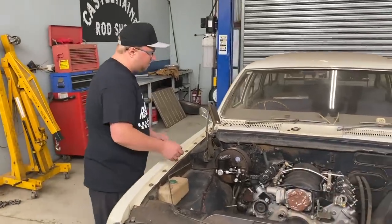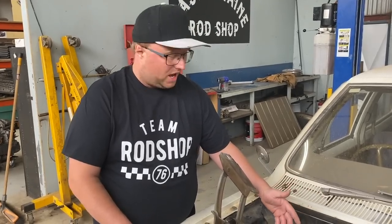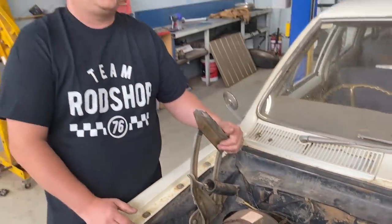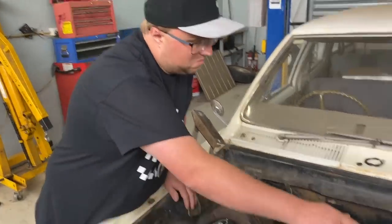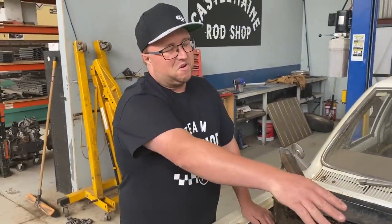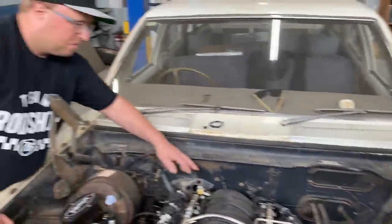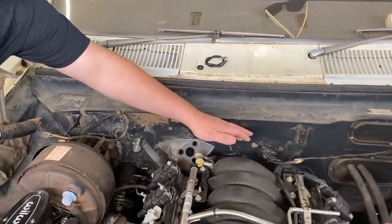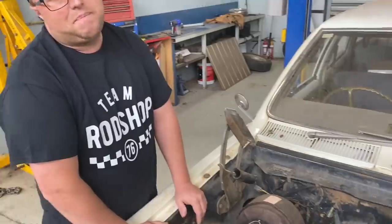Everything stays the same on the driver's side — headlights, wiper, washer bottle, horn, everything worked in this car. With this setup, we've fitted the LS engine. We've had to relocate the wiper motor up underneath the dash. We're just going to pull the wiring back underneath the car, hook it into the new position for the wiper motor. On the passenger side, we'll start with removing the old battery cables — they're no longer going to support the LS engine. We've got the external regulator, which we no longer need. All the wiring from this plug will be pulled inside the car, as we're mounting all the fuse boxes, relays and ECU up underneath the dash for easy installation.